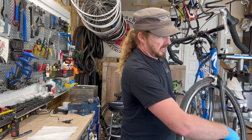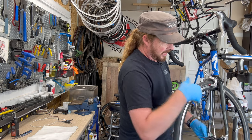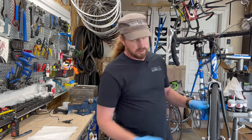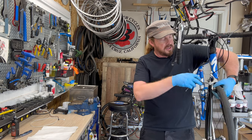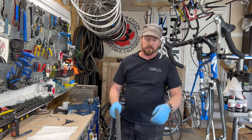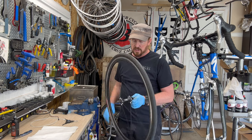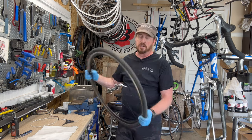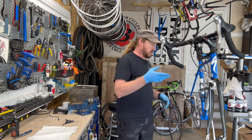These brakes have opening safety catches — they used to call them lawyer tabs back in the day. You can see the same issue: the tire doesn't want to drop through easily. This individual knows how to handle that with an allen key to open the brakes and readjust cable tension to accommodate the wider tire. Feeling the front hub, it feels a little knocky and tight, so I'll definitely take a look at that and maybe pop it open and inspect those bearings and races.